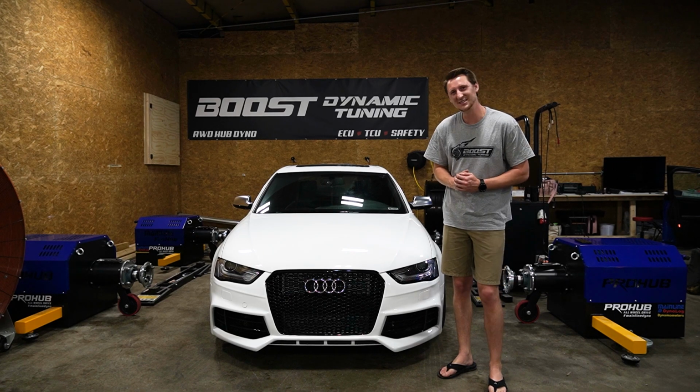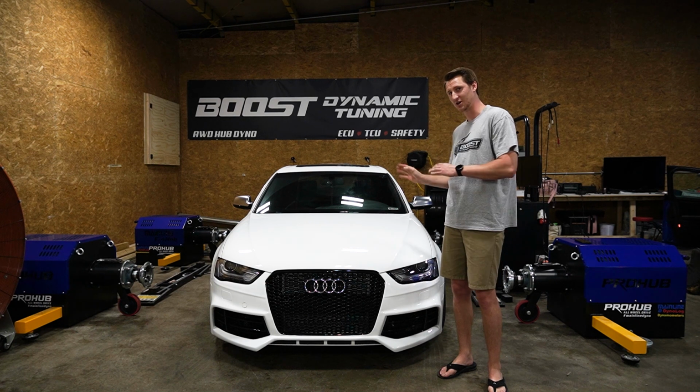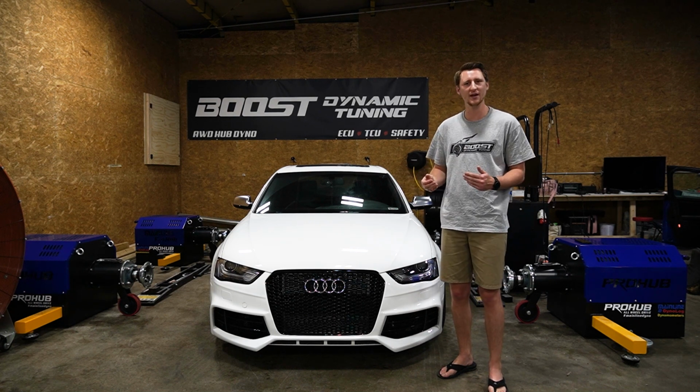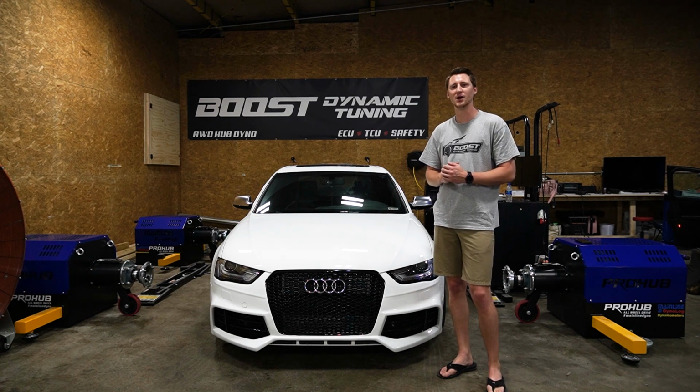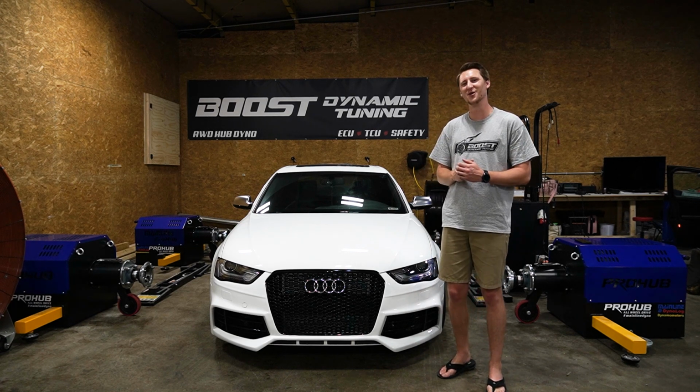Alright guys, getting back into it. After checking your fluid, after starting the car multiple times, running it through the gears, check your fluid one more time. And once it's all topped off, now it's time to drop the car off at Audi. Get it programmed. No fun, right?